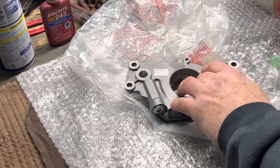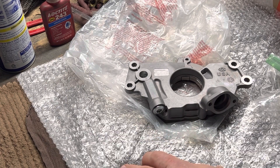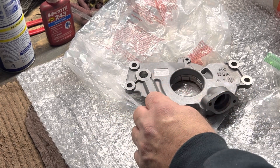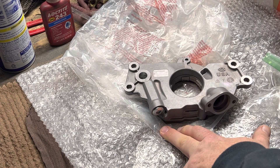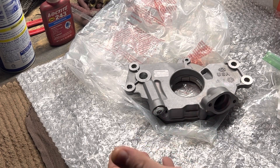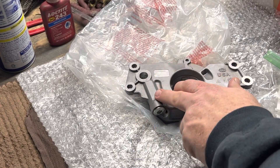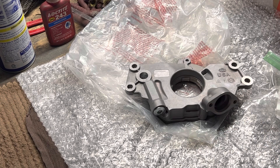Stock Chevrolet says their pumps are 60 pound, but it's not really a true 60 pound pump. The factory oil pumps on the LS engines - I'm talking about the original LS engines, prior to DOD - are rated as a 60 pound pump, but the spring they put in there starts bypassing oil at about 53 pounds. That's fine for a completely stock engine not revved over 5,300 RPM, but when you exceed 5,500 to 6,000 plus RPM, you put that oiling system in a deficit where it's bypassing at 53 pounds, reducing your oil volume to feed your bearings at higher RPM. Bad combo.